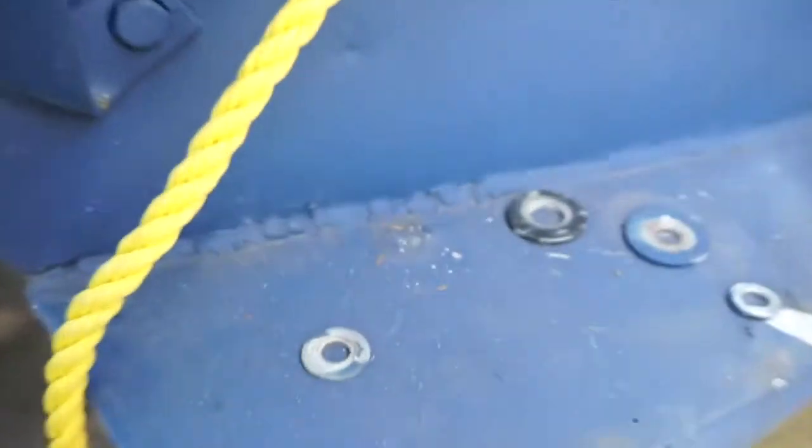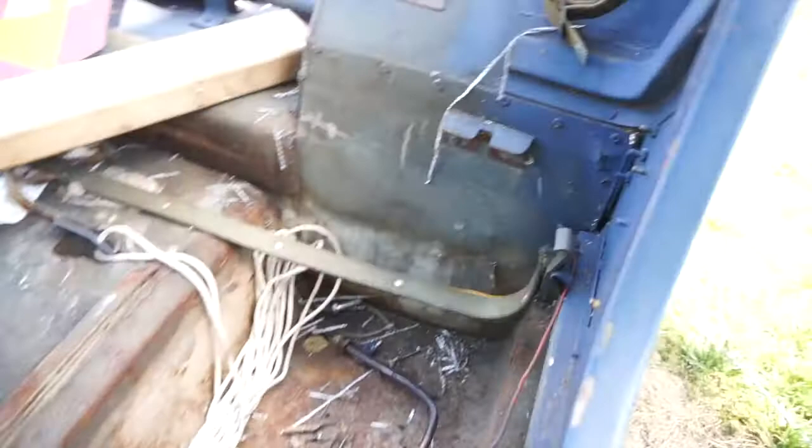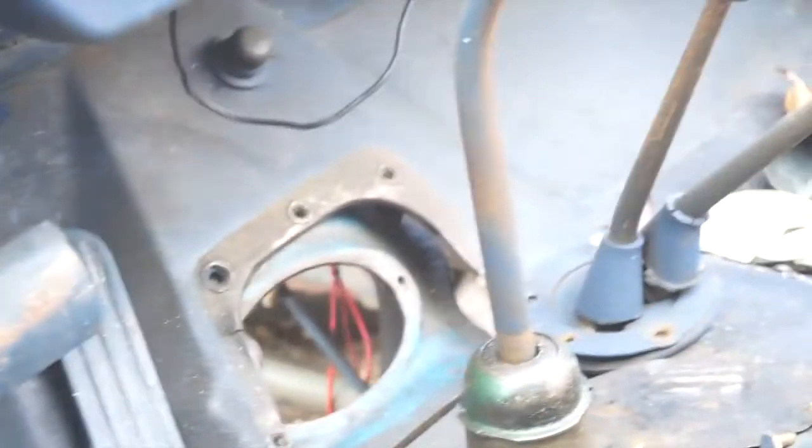I don't think I'm going to replace that whole section of frame. The top part is good — it's just the bottom part that needs replacing. There's the right side showing that it really doesn't need that much work done on it. That fender is still on there because it's welded to the frame. There's the little foot rest right there, it's welded there — it's there on the body for sure. Now there's the fuel sump, it's pop riveted in there with some other sheet metal. Pretty much sheet metal and just 1/8 inch plate steel everywhere on this Jeep. You can see that floor pan is completely layered — the old one is still there underneath, but it's not ideal, so that will be going away.